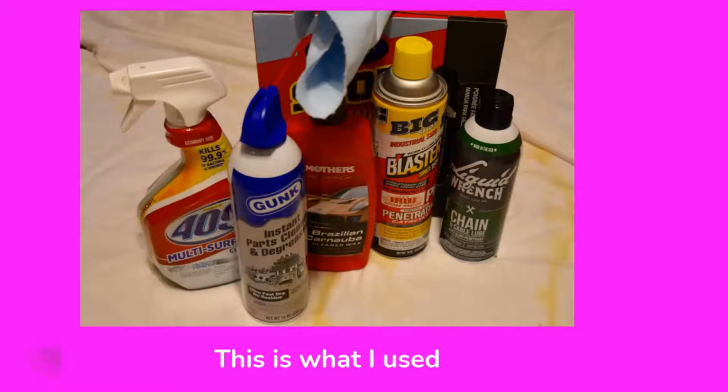anything will. And for the chain and cables, use a good quality chain and cable lube. The kind I purchased was Liquid Wrench. Picked that up from the local auto parts store. But that's what you should be using on your cables and chain. They make specialty products such as chain wax. I've never used that much, and I've always had really good luck just using the spray chain and cable lube. And also, I use plain old carnauba car wax on this bike.